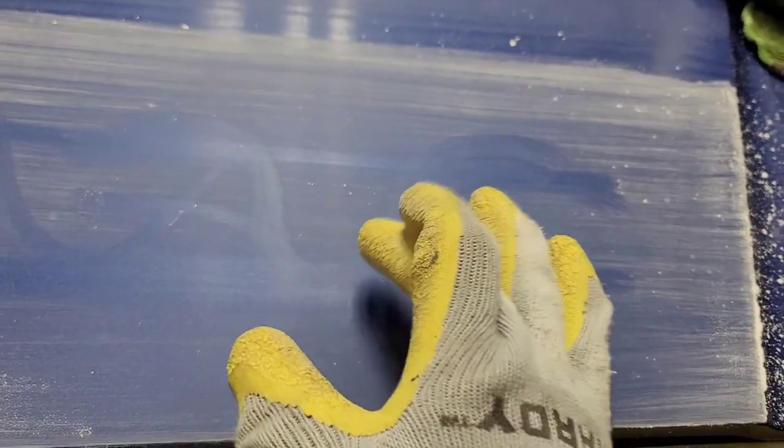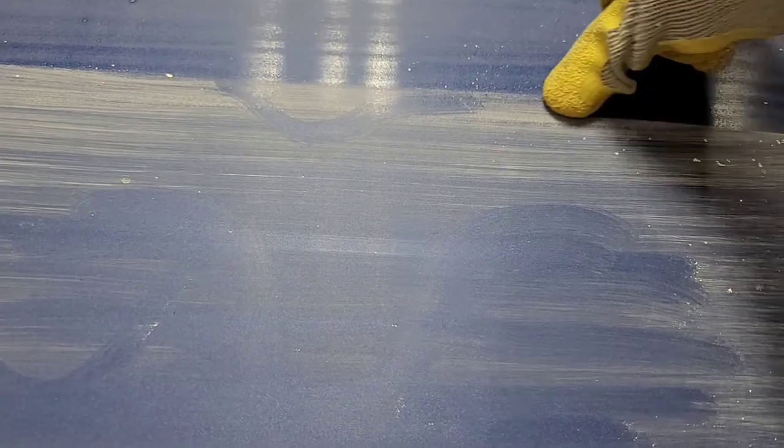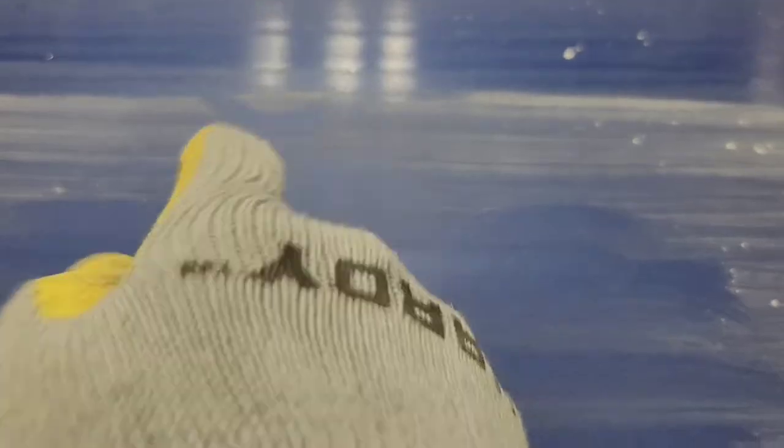So the way that I do this, I put on one light layer and it's encapsulated, and you might have a small indentation, but then the next layers are going to go on top of that and leave you room that you can sand through that fisheye. So let's say this is the top layer of your clear, and let's say this is a fisheye right here. With the first level of sanding, I'm removing about that much, okay? And notice that there's still a little bit of that fisheye left.